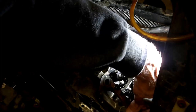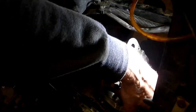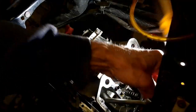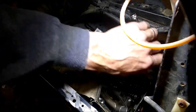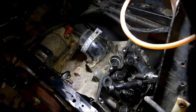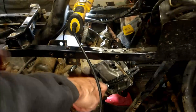You'll have to take the flywheel off also. Keep in mind after these four bolts, there are two down here by the opening. Take that panel off to access the chain and the gear. There are two 8-millimeter bolt sets to unbolt. Now this one I left so you guys can see how I crack it open — she's pretty tight, just take a hammer and give it a little pop to break it loose.